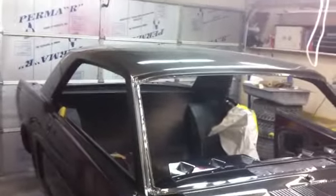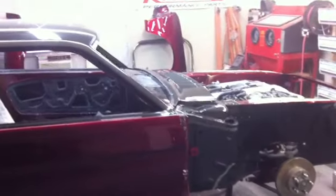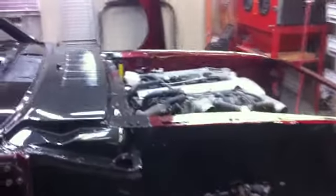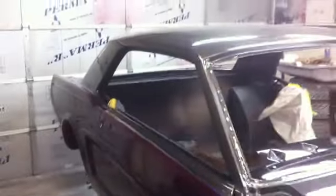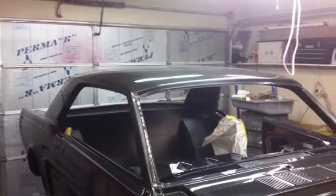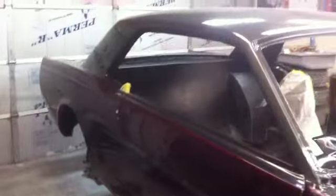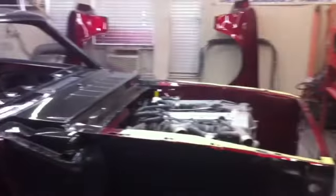I've got to make some brackets and do some things to get working on the brakes. We're going to cover the car in plastic — all the panels — and tape up each individually so we can still get inside the car, because we've got to do some cutting, grinding, drilling, and bending. We don't want all the dust and metal filings from that landing everywhere and grinding those filings into the paint. Should have done that before — somebody who watches these videos mentioned that — but we'll do it today.